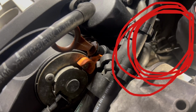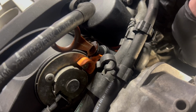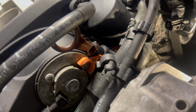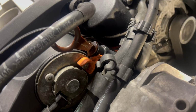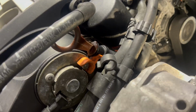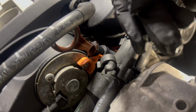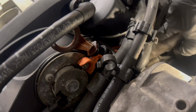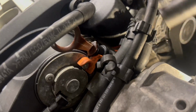There's a little square here, and it's a bugger. I forget. There's like 10 different styles. Oh, there it goes. So what I did was I went this way, and I tweaked it this way, and it pulled right off. So for the camera guys, we're gonna bang this puppy out. We got the old 24 millimeter, and if you see this, see that oil? That means it's bad. That means the sensor itself is letting oil through into the electrical outlet.